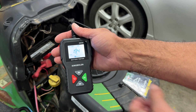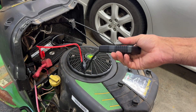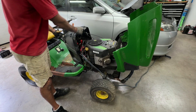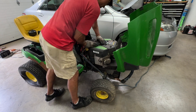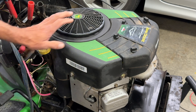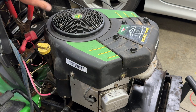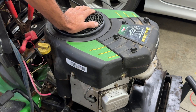So this battery I'm going to have to change. It's a little weak, so I'm going to hook up the jumper cables to it and show you what it does. Put the brake on, turn it over — locks up. Locks up again. When the motor locks up like that, it could be a bad battery, so we want to eliminate that. I tested it, it was a little weak, so I put jumper cables there. Another thing is a weak starter — we're going to check that out in a few minutes.